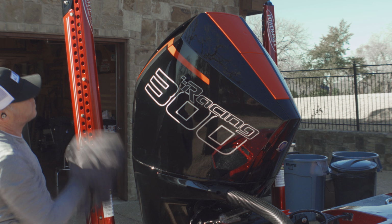This tool right here comes in so handy on spots like these, those intricate spots and hard to get to places. It's the Rupes Hybrid Nano. And I have the same thing on there. I have the yellow polishing pad from Rupes, and I use the Glidecoat Nano polish and get really good results out of this. This thing has saved me so many times to get into some spots that you can't with a regular size DA polisher.